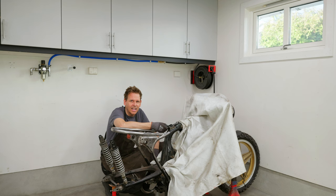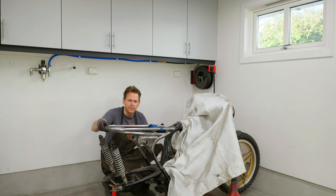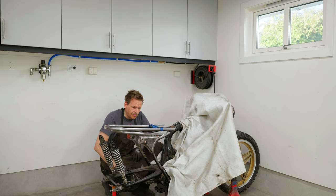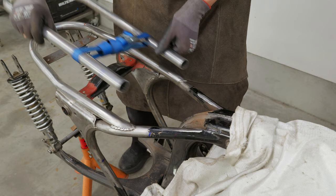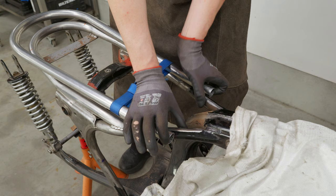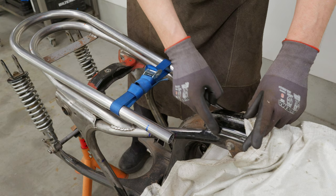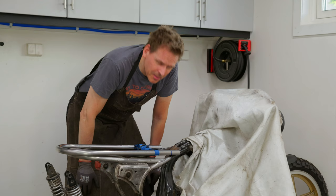So removing this tab wasn't that scary actually, but the next part is the scary part, because now I will need to make four cuts and then take off the old subframe. The plan is to cut the original subframe exactly where my new one starts, and then add a tab here — weld on a tab to connect them, and maybe a couple of support tabs if I feel it's not stiff enough. I have a 6mm flat bar I can use for it, it's the same as the original, so I hope that will be plenty strong enough.